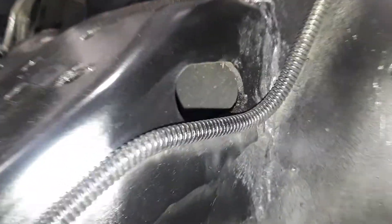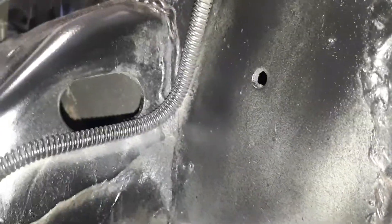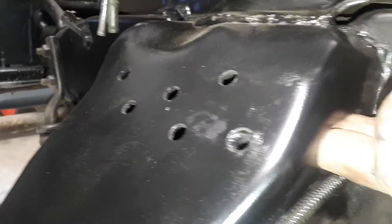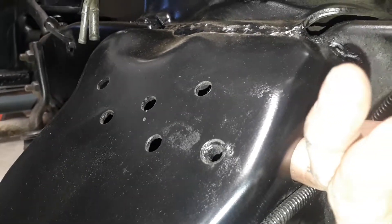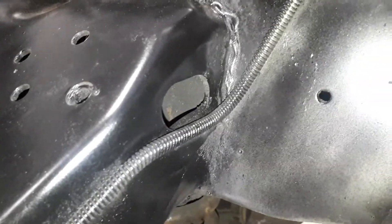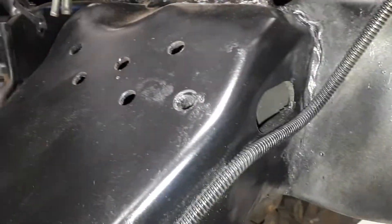The other bolt you're in really tough, trying to reach up through here on the top side of the lower A-arm. What I discovered is that the passenger side of the frame has these convenient knockout holes - kind of an oval-shaped hole, I'll show you the other side. See that? That makes it quite easy, because all you do is take your wrench, slide it in here with the nut - which has a nice shoulder on it - slip the nut in on the wrench into the hole, get it positioned, put your bolt in from the top and you're good to go. The passenger side is quite easy; you might even be able to do that with the motor in.